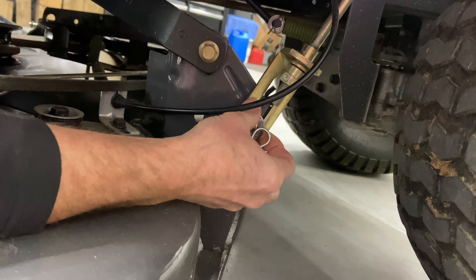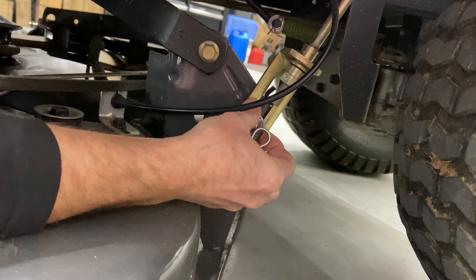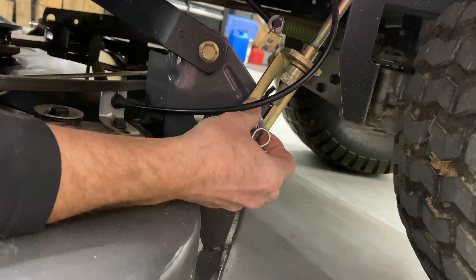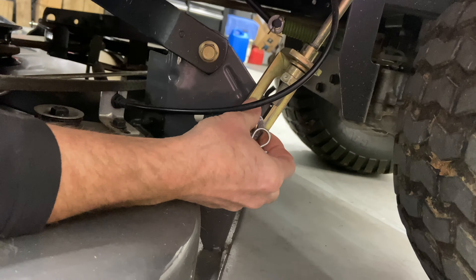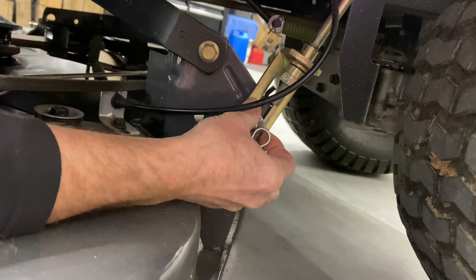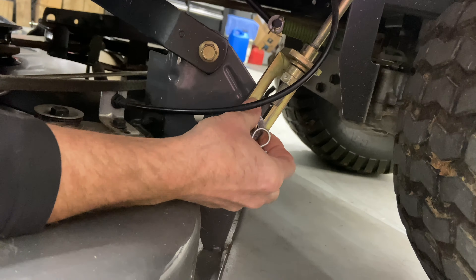I'll drain the oil while cleaning the mower deck. Twist the drain halfway to the slide position and pull it out. I pulled a little too far and it popped off — that's one reason people don't like these. So I'm actually going to replace this with the John Deere style pipe thread drain. Using Teflon tape or pipe dope liquid Teflon, screw it into the block and you're good to go. I'll take this off using a 15/16 crow's foot turned counterclockwise.